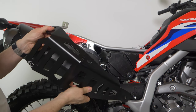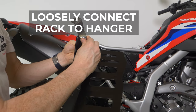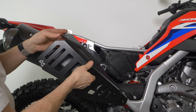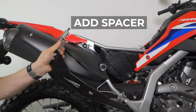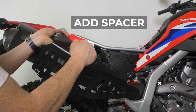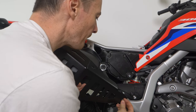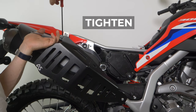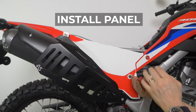You've got to make sure it's the right way up. It's quite important that the bolts you put in are quite loose to start off with — it's really going to help you align everything if you keep those loose. Put the washer on the bolts, put the bolt through the hanger, put the spacer on the other side, and that's what you're going to use to connect it to the frame. Put that in finger tight because we're going to have to remove it again when we put the seat back on. Once you're happy that everything is aligned, then you can tighten. I'm just using a spanner under there. Once that's back in place, you can install the panel. That's the right side of the bike — really straightforward. It goes on in a matter of minutes.